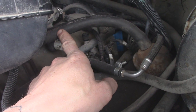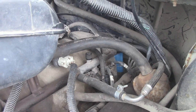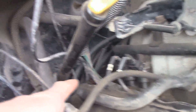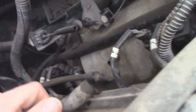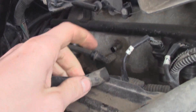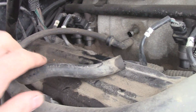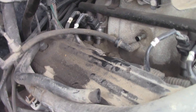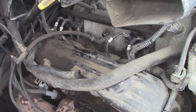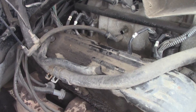You're gonna want to find this hose — this is your crankcase breather. That part is important. Second part is your PCV valve, right here. First thing we're gonna do is pop that off of the intake. We're gonna cap this and cap this with the tape. That will prevent — if this is leaking — it'll prevent it from leaking vacuum into the crankcase. We'll go ahead and tape those up, and then I'll show you what to do next.